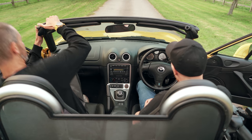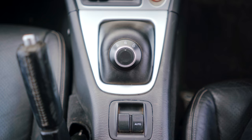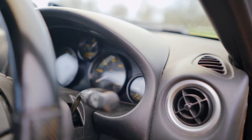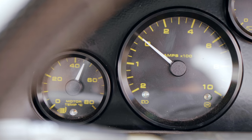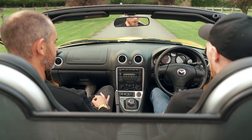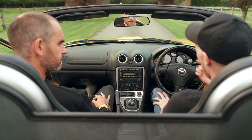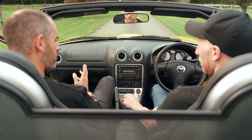I'm not an MX-5 aficionado, but I'm going to say it looks pretty much stock — apart from there's no gear lever, there's now a knob. And we have different gauges. They're all different — this is actually a Speedhut setup they've supplied to us. We've changed it out so we've got amps instead of RPM, and then motor temperature and battery temperature, and state of charge in the middle. They're the same sort of layout as original — it foxed me, I didn't notice. But they are EV-specific now, with some cool extras like the green light flashing when you're charging, temperature warning lights, and a low state of charge warning at 10%.